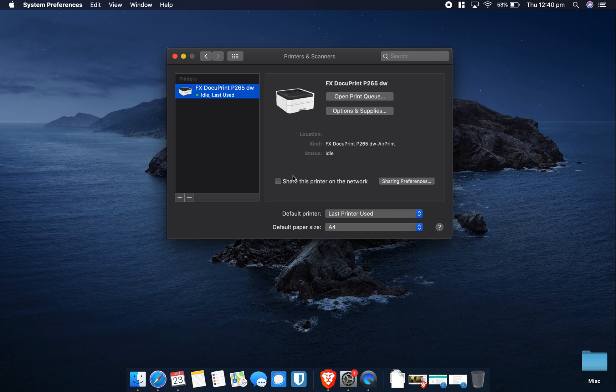If it's added successfully, going to print something should now work. But if this is still not working, or you can't delete the printer for some reason, you can take it to the next step. Hold the Control key while clicking on the printer to get more options. You can actually reset the entire printing system. This is more extreme than simply removing a printer — it resets a lot of settings to default and clears any cached drivers. Reset the printing system, re-add the printer, and nine times out of ten you'll fix the issue.